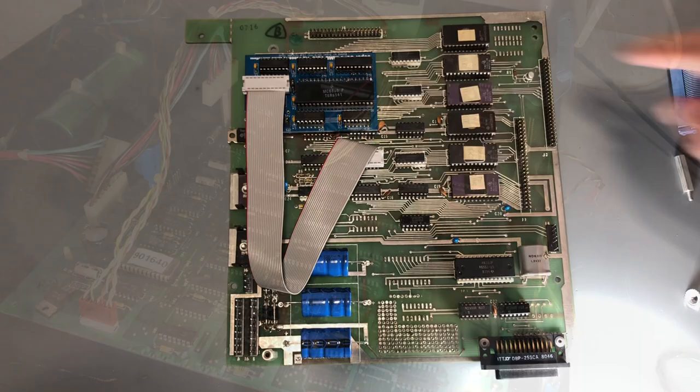Back to the SuperPet, and I'll show the running processes again. The design is very Unix-like. You can see that every process is running as the root user with UID 0. Process ID 1, sysgo, is the equivalent to init on Unix. Process ID 2 is the shell I'm running on the console. Process 3 is the TS-Mon process I executed. And Process 4 is the login shell running from the VIC-20.